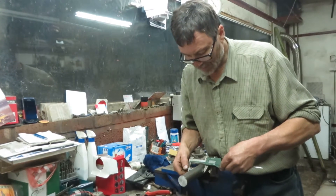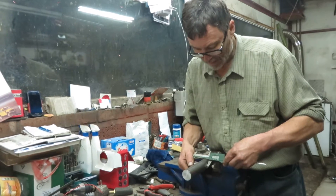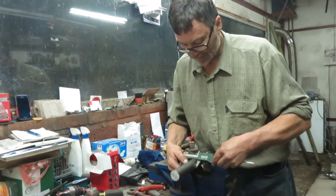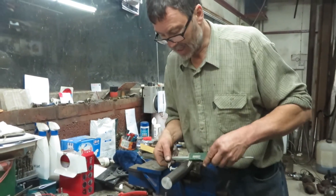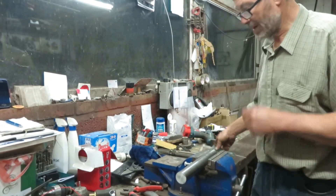Let's try again. 1.198. Screw it in slowly. There we go — 1.18 inches. And then we can just lock that up with a spanner. Check it again. 1.179. That's good enough for me.